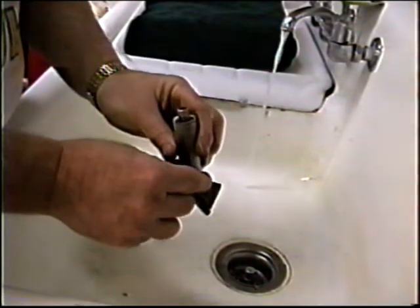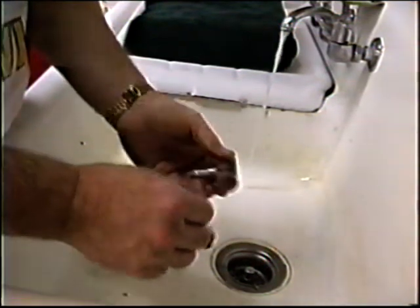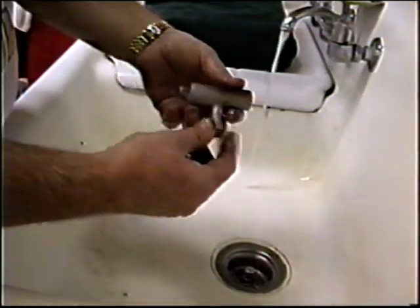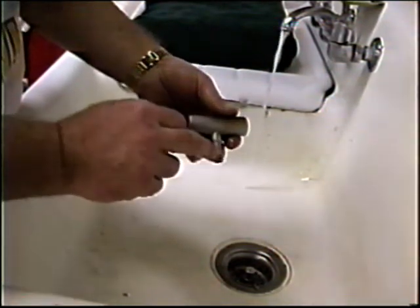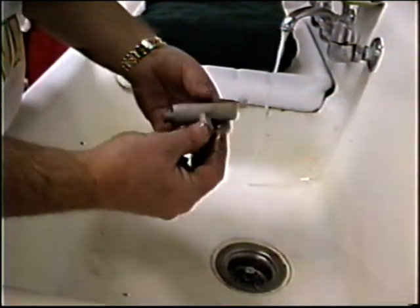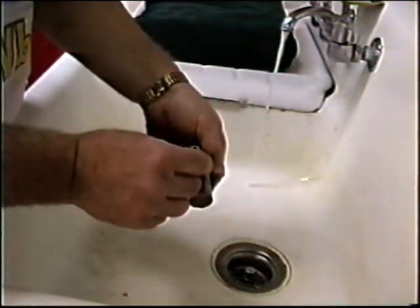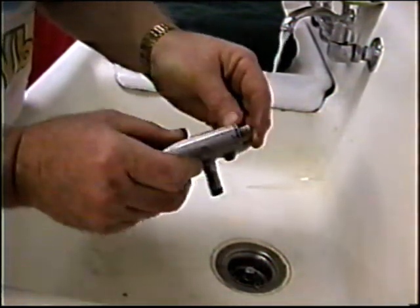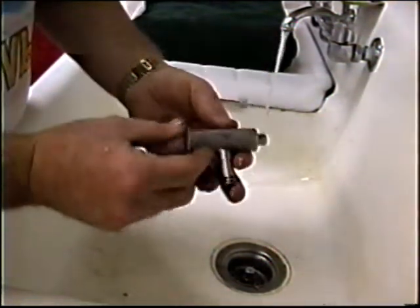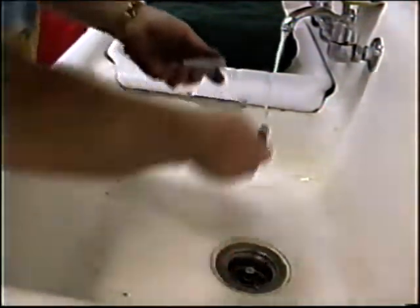The muffler is made really well. This is really a piece of work. It's got a baffle tube inside. Now, anytime you bend sound 90 degrees, supposedly you lose half of the amount. And I like the way this is made. I think this could be adapted to anything, really. Really nicely made. I'll have to pull this apart. It comes apart here, I can see. Or just replicate it or buy one.